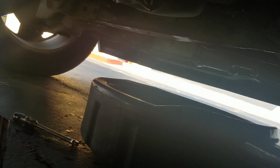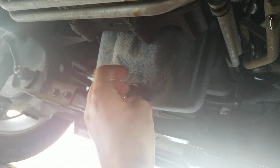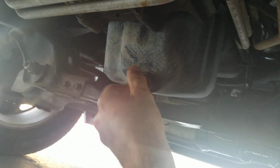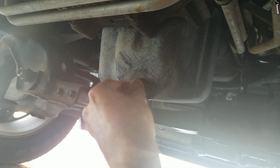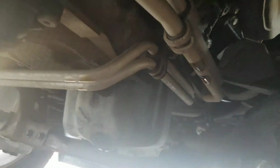All right, I'm gonna have to keep waiting a few more minutes. All right, so it just keeps on dripping for 20 minutes, so I'm just gonna put it in. I'm sure there can be just a little bit of oil. I don't sit here for 30 minutes, so we're gonna screw that back in. We're gonna get our 13 millimeter socket, and we're gonna tighten it up.